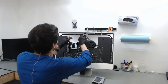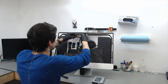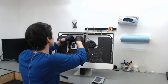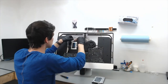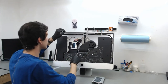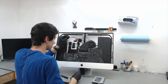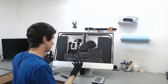Now we're ready for the adapter. Take the male part of the adapter, plug it into the female of the SATA cable itself, then bend it back and have the female part of the SATA power adapter on the thermal sensor plugged into the solid state itself. When you're done you should have something that looks like this — it actually has more slack than if you had the cable underneath. The thermal sensor has double-sided adhesive held down with a film — peel off the film and put it onto your solid state.